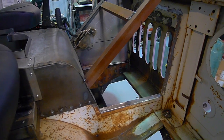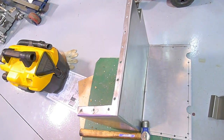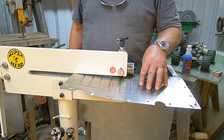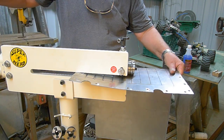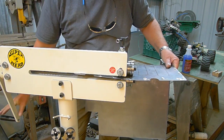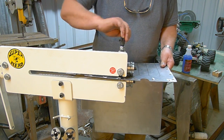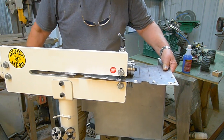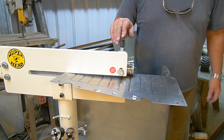With the area all cut out, I'm gonna put a piece — which I just made — in there. That's the piece that's gonna be the floor and the wall. This part right here is gonna face the grill in the front of the Jeep, so I'm putting some ribs down there and I'm gonna paint it black. I'm using this bead roller — pretty easy to do. I got this from Woodward Fab. It's a really good bead roller; it's got a long throat to it. Just set it up, clamp it down, and roll a nice groove so it's not just flat metal.